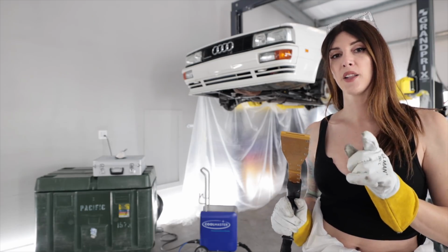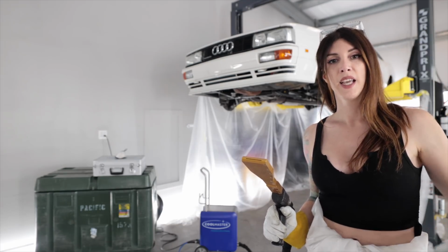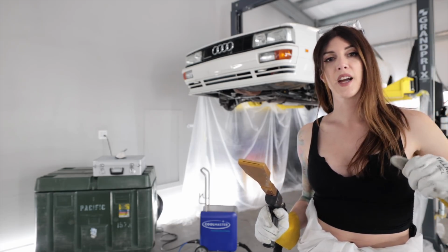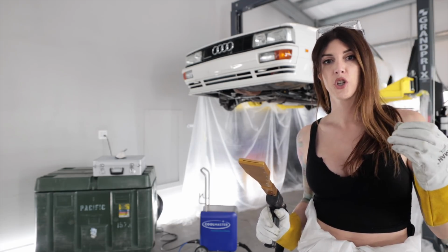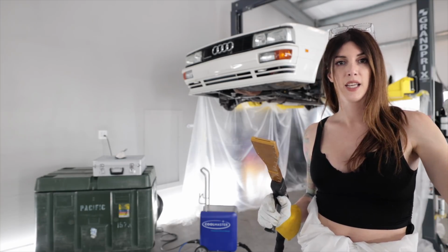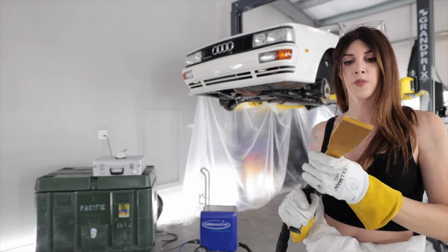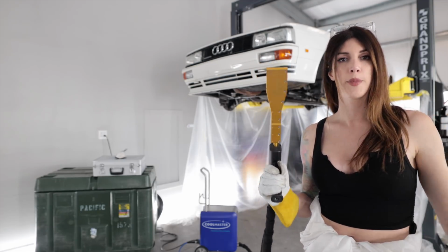Yesterday, one thing that I learned is it's best to let that hopper run all the way empty and then blow it out with compressed air, because if it starts to build up moisture in there, these little cups, the holes that the pellets fall into and then grind up, if they get moisture in them, it just creates like a snowball. So you gotta completely blow out the entire machine, because moisture in dry ice just creates sludge. But other than that, it's just kind of common sense based.